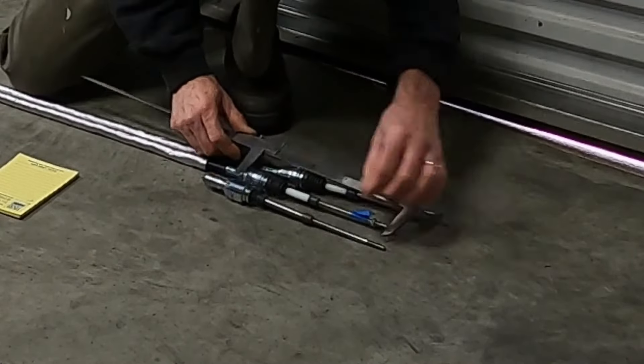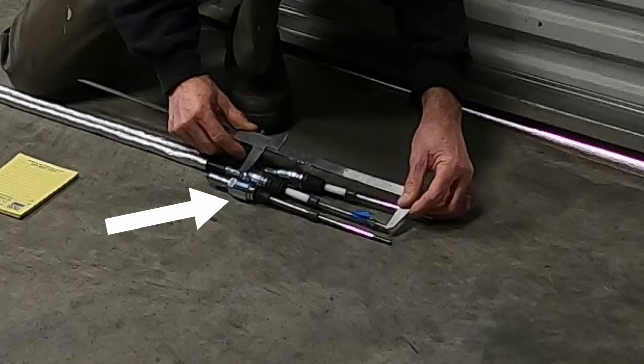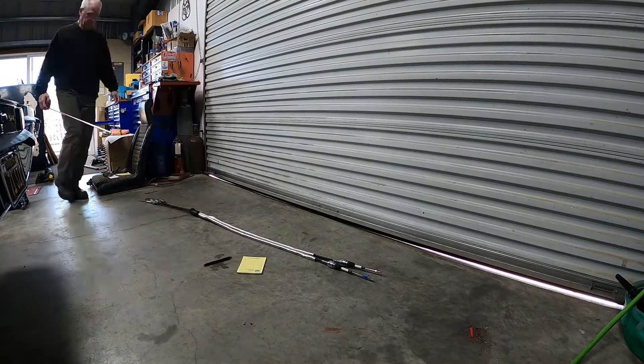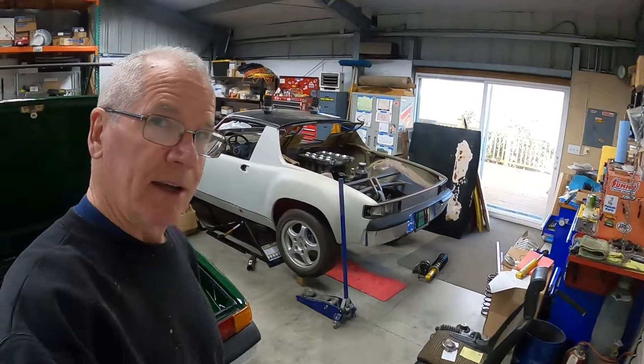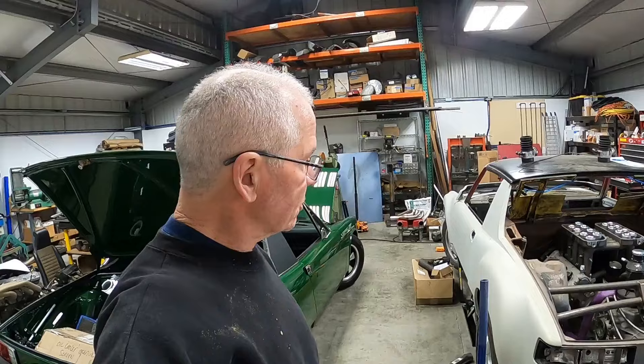It was time to measure up the cables to determine what to order. Control Cables has a worksheet — I took the test piece, used their dimensions, positioned it against the Ferrari cable, measured from their recommended starting point to the end of the Ferrari cable on all four ends, determined the overall length, and remembered to subtract 12 inches from it. A little precise calculating and I have the specs. I'll get that order placed, and with a bit of luck in the next episode we'll have the cables here, back in the car, with the shifter hooked up. Really happy with that — major milestone. As always, appreciate you guys watching, leave a comment, and if you haven't subscribed please think about it. Take care, bye bye.